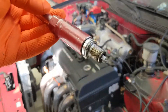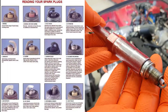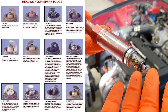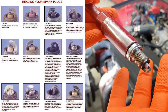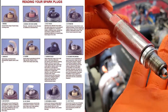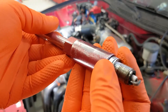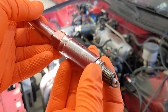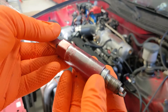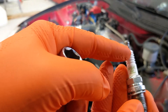We can look at the plug itself and it gives us a window into what's going on inside the motor. We can look at this plug and see if it's all carboned up, if it's black, if it's wet with fuel, if the spark's not firing — if it's all carboned up, we're too rich. If it's really white and burnt looking, it's too lean. I'll put a picture up there so you can see what the plugs look like under different conditions. Also pay attention to the little crush washer on here. Some of these plugs have a one-time use crush washer, so if you remove the plug you're supposed to replace it, because once it's been crushed it needs to be replaced. We can also see our part number on here and inspect the plug for any burn marks. We've got porcelain on the outside, a steel part up top, and a copper core that runs through it.